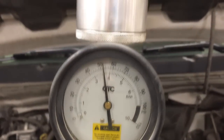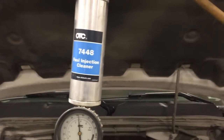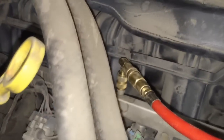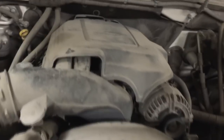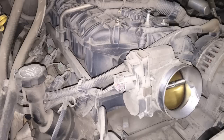Run your cleaner through the tool until the vehicle basically starts running rough, which in this case took about 10 minutes at the most. Then shut things off and remove your tool. Be sure to reinstall the cap on top of the fuel pressure service port on the injector rail and reinstall any engine covers — in this case there's a cover over the manifold area that you'll need to remove to access it.